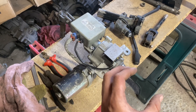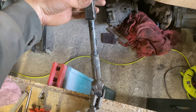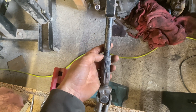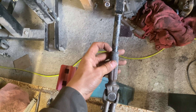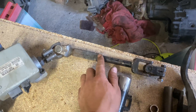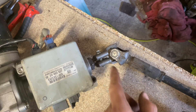I'm going to try to explain it with the aid of some pictures because I don't have the original parts. Basically, with this UJ down here, this is the Corsa half and this is the Mark 1 half, and the two of those actually fit quite nicely together — it's a sort of sleeved fit. That Mark 1 shaft runs right through the Corsa end. You could drill a hole and pin this, or sleeve it even further and get this joint welded — then that would be good to go. You can obviously bolt this straight up to your Mark 1 steering rack because the UJ is just the same as it was. You just need to make sure you've got nice clean strong welds and that the join of these two is strong, then you can use the Corsa clamping UJ on this end of the shaft.